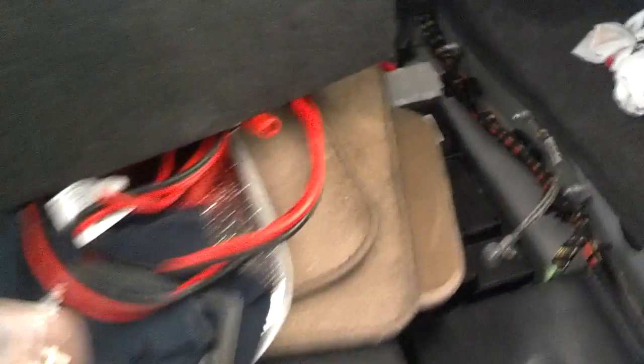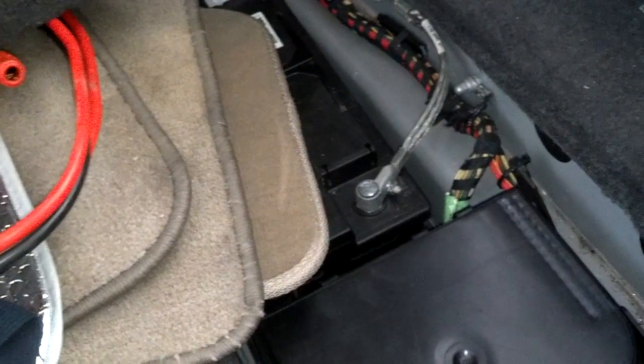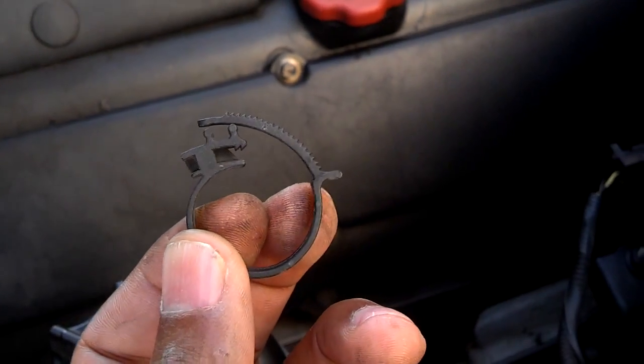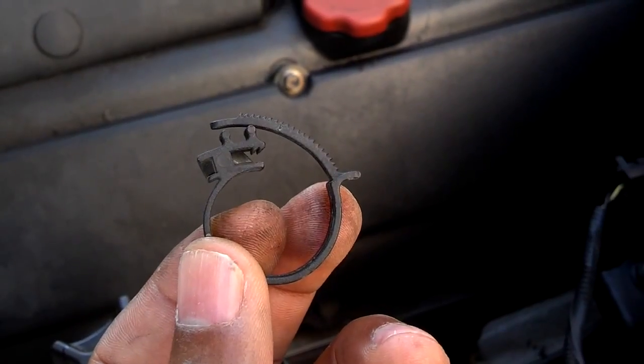Go in the trunk, move everything off this panel, lift this panel out, and take what looks like a 10 millimeter — disconnect that and insulate it so it can't reconnect itself. Next, release the clip from the brake lines, and then another one on this side. The clip kind of interlocks with a zipper effect, so just unzip them and take them off.